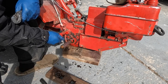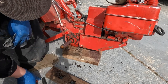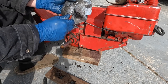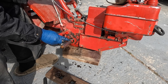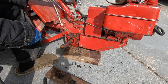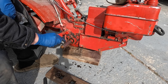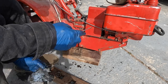Now it looks like, unfortunately, there's a little bit of a groove. I can't tell exactly how bad because my finger won't go back there. Some garbage got behind the seal, you can see. I think I can just feel it with the pick. I think we're gonna try maybe getting some light sandpaper or emery cloth and clean up around there. We're also gonna need to clean all this grime off so we can get the new seal on without damaging it. I'm gonna go grab that sandpaper.